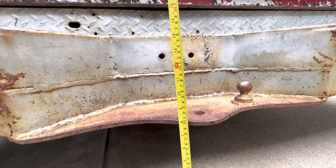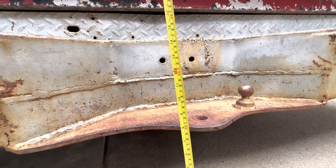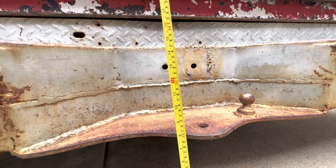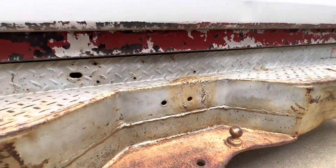Which means we need to raise this thing. I think ideally 16 is perfect for my trailer. Probably want to be a little higher than that to account for sag of the springs, so let's say 17. We need to raise this shelf seven inches.